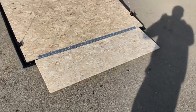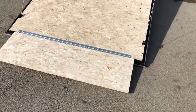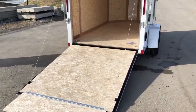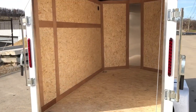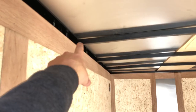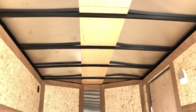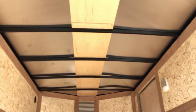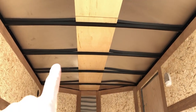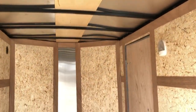This unit does come standard equipped with a ramp flap extension, giving you a nice low load angle. It tapers down to about a 3/4 inch knife edge, ideal for loading anything from a hand truck to a garden tractor. This unit also has a 3/8" wall liner, a little more sturdy than Luan. Again, 6'6" is going to get you roughly to the bottom of the bows. This is also a one-piece aluminum roof with tube bows — no Z-post or hat-post. A lot of cheaper manufacturers use hat-post ceiling and Z-post wall; this is all tube with a one-piece roof.